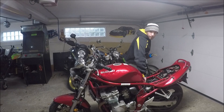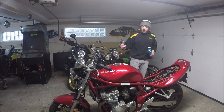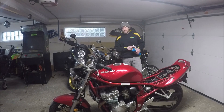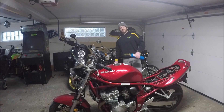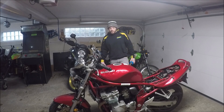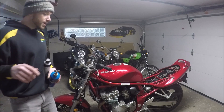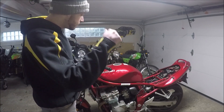With the air box off and no filter on it, if I covered up the intake a good bit it actually started to run better — more normal. Not exactly certain how that's affecting things. What I'm going to do is turn the bike on, let it idle, and shoot a little propane from a torch — without lighting it — around areas where I expect a vacuum leak, like the intake boots. If the RPMs change, I've spotted a potential vacuum leak. That would save me a hell of a lot of time instead of ripping this whole thing apart and changing all the settings.